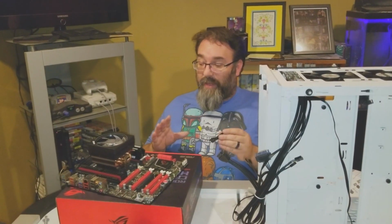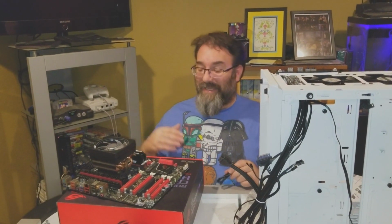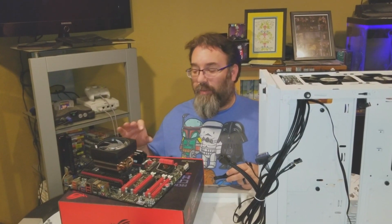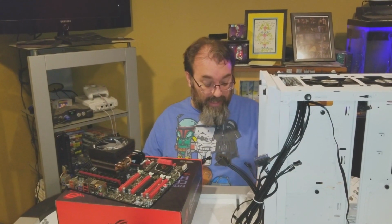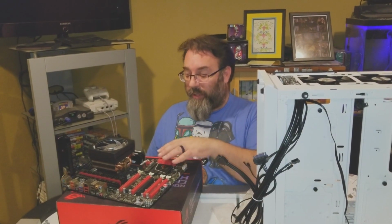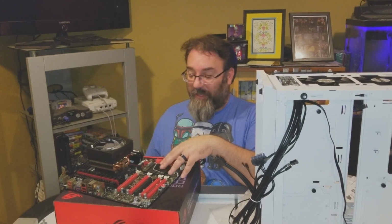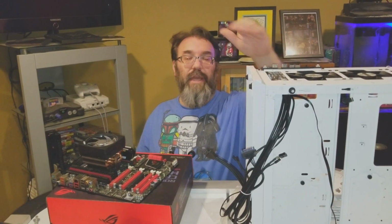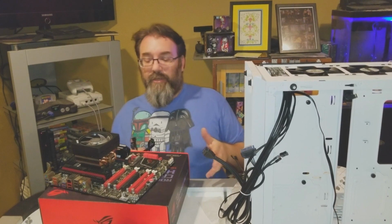Okay, so I'm back. I just had to look this up really quick. Like I said, I have not had a whole lot of experience with these RGB headers, so I was not 100% sure of which one of these cables to use and how it hooks up on here, or how I was even going to hook it up on this board. Now this board does not natively control RGB, so that's why I'm going to be connecting it into the RGB controller up here at the top of the case. That way everything is controlled through the case, and it'll be a little bit easier to manage.